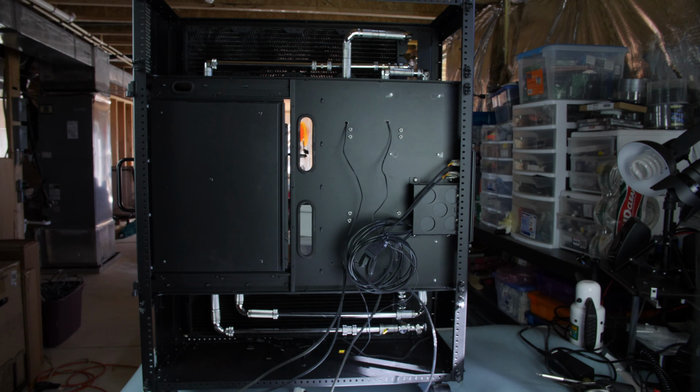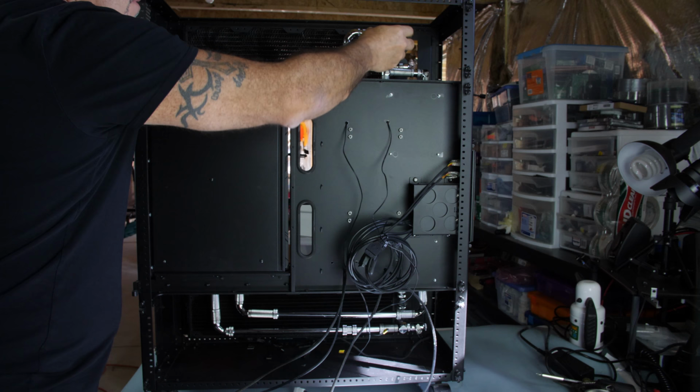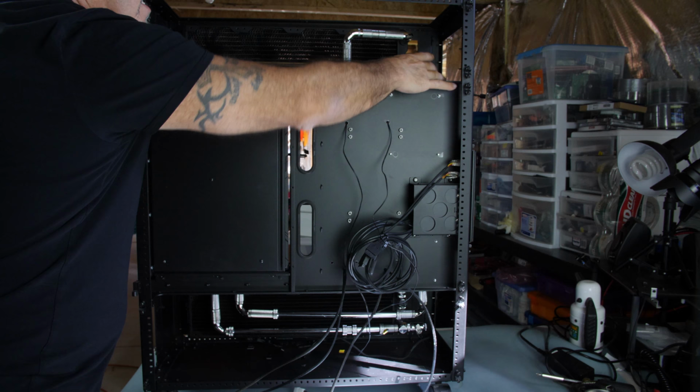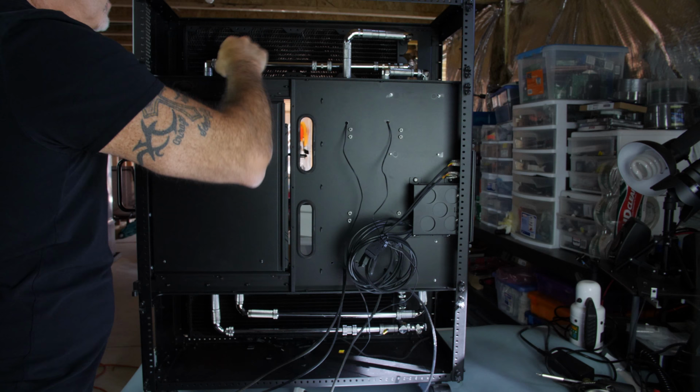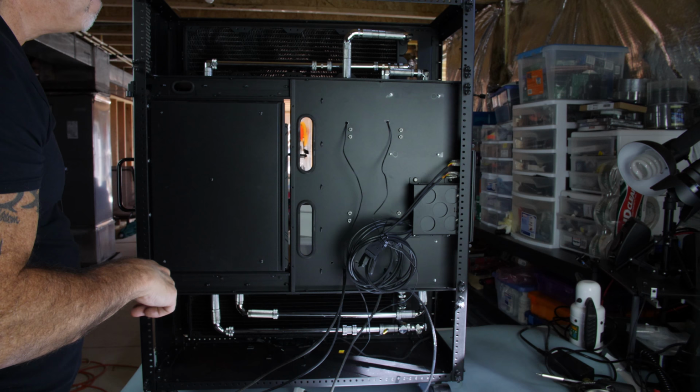Now some people might ask, why didn't I cut a piece of tubing here? Again, there's nowhere to go. In order to cut a fit, I have to be able to screw them in. And if you have exactly the same length, you're going to need either these T's, these telescoping Aqualink pipes, or D plugs. So to fit these in here, I was able to cut these up right, and I had couplings, and then of course I had to use a D plug or an Aqualink adjustable tube, or sometimes both. So that's the tubing runs. I think I got them all.